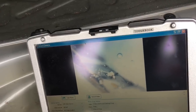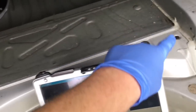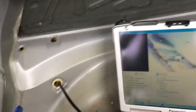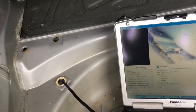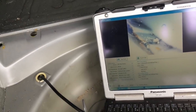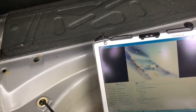Those are the areas we need to get to inside underneath the car in the back area. We're going to need to take the sound deadening pad off and all the seam sealer around the perimeter, then take two MIG welds out down the side, ten spot welds across the top, and make an incision cut all the way across this boot floor panel. We then remove the front edge of that boot floor panel to access the top internal sections of the rear axle carrier panel and carry out our spot weld repair and crack repair by welding, then reinstate it, put it all back together, and carry out the paint, seam sealer, and sound deadening pad installation.